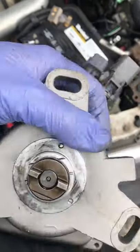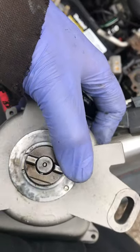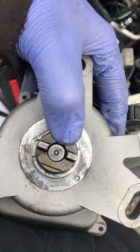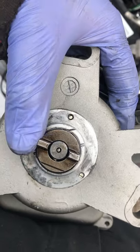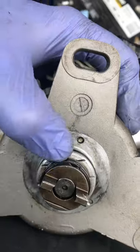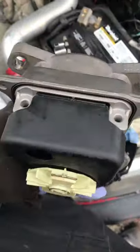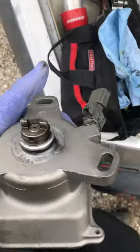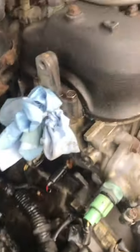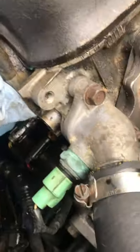I got the three 12mm bolts off and the pigtails off. If they give you any trouble you can stick a small flat head underneath and wiggle-jiggle along the borders. Wiggle the distributor out, noting the position — sometimes it will move. On models that don't have the safety groove you can mark the position with a couple scribe marks or a paint marker just to note where the grooves are at. This is the part that goes bad right around here — the oil seal. It has a snap ring.